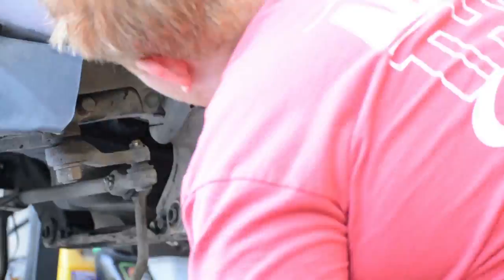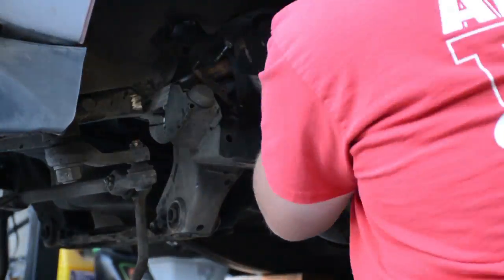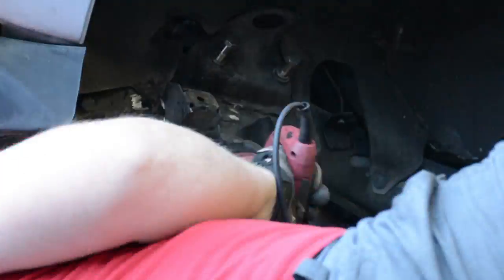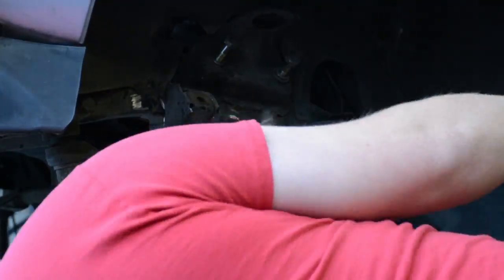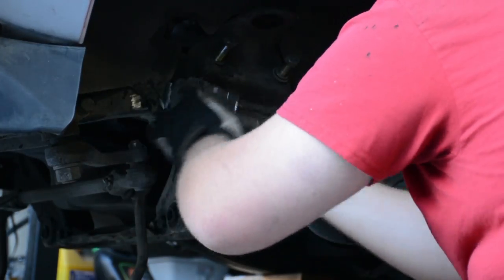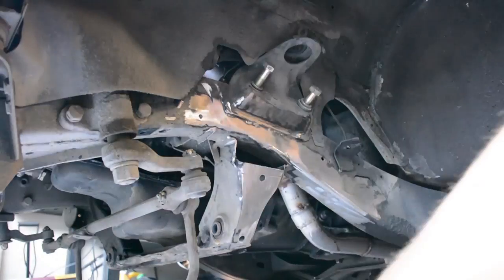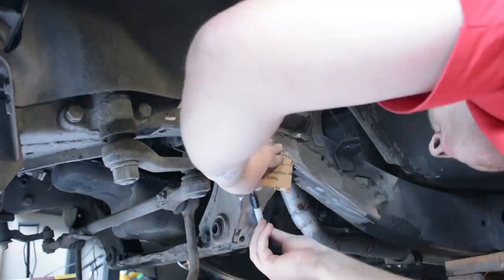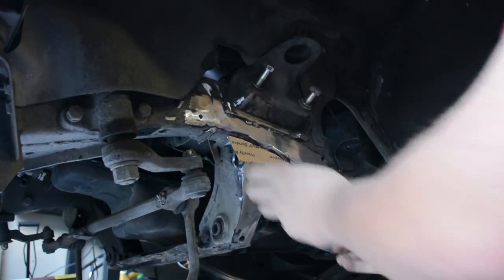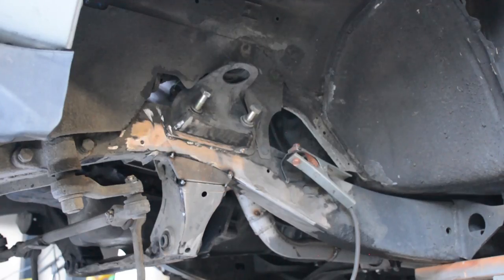Now comes the fun part. I recommend a sawzall — I really don't like using cut-off wheels, they can be really dangerous, so I try to use a sawzall as much as possible. If you had a handheld plasma cutter or acetylene torch that would work really well too. I just worked at it and beat it around with a hammer to get everything off. I didn't record it, but got the frame all cleaned up and the tabs removed — that took a while. Now I'm making a cardboard template to fill the hole. On the Hardbody there's a small hole when you remove this stuff, so you make a filler piece, cut it out of 3/16 plate, and weld it in.